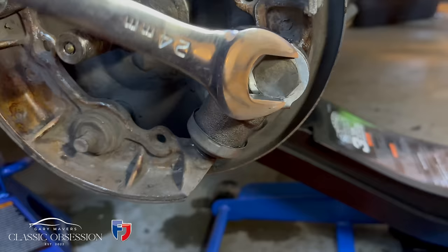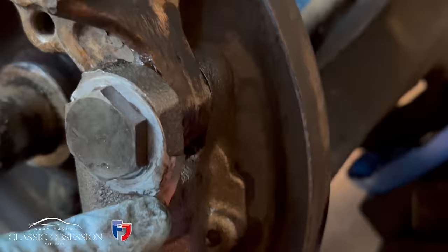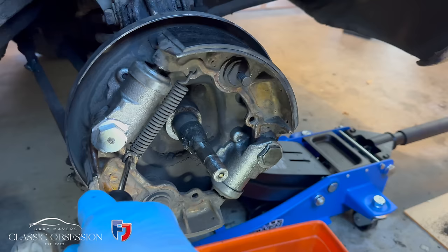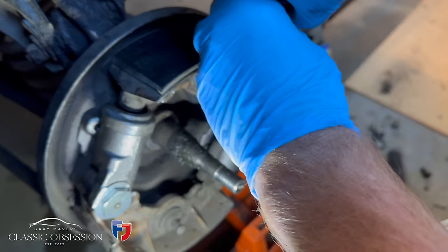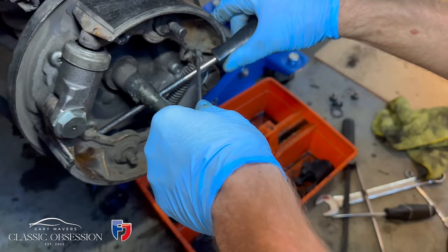And again, when you're tightening the main bolt, don't over tighten it, because you'll split the cast in half. And always make sure your tabs, one goes one way and the other, to lock things in. Fun and games.